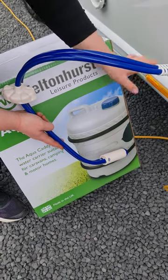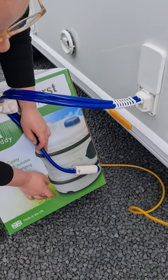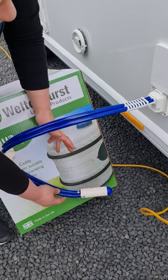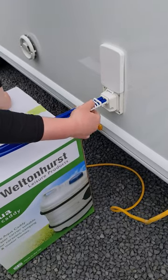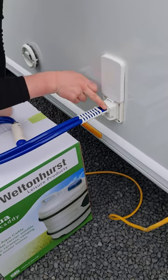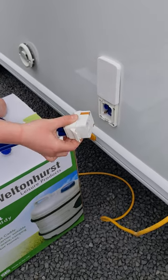There is no gauge inside the van or on the barrel, so you need to keep an eye on it. You don't really want it to get below about a quarter empty, because the pump can start to curl up out of the water and run dry without you knowing. When you go to remove the pump, hold it from the base — don't hold it on the skeleton part, because if you break that it will let air into your pump.